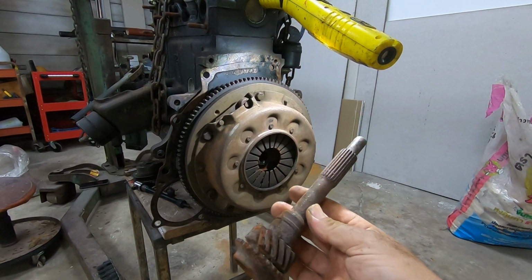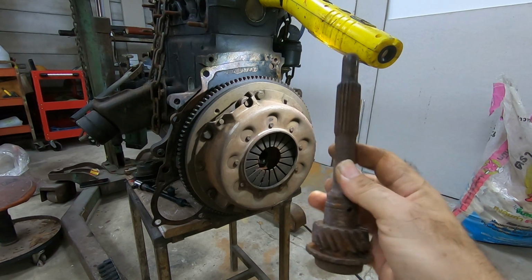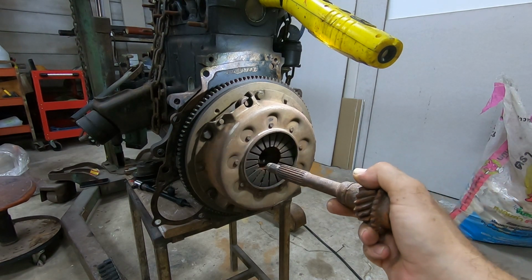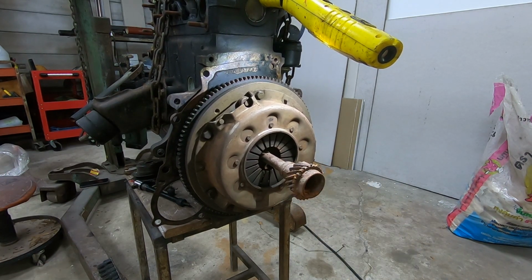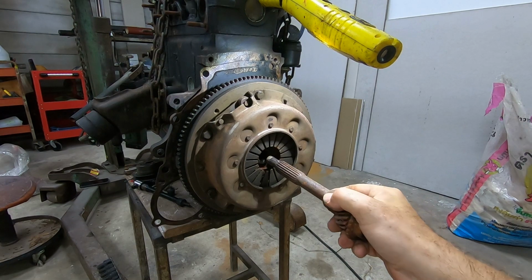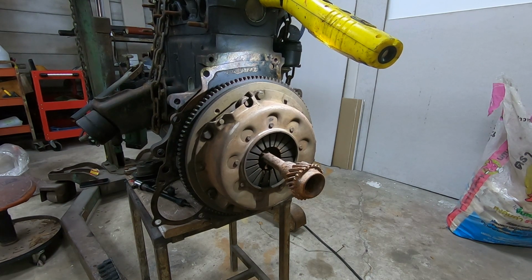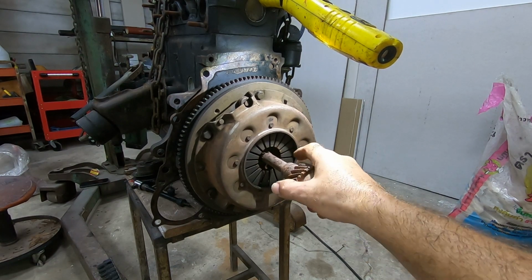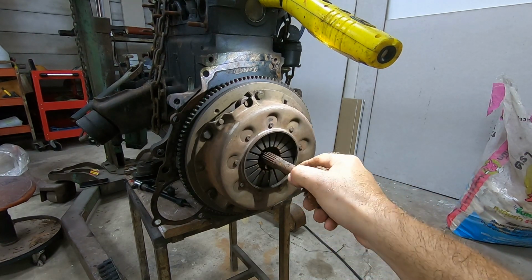What we have here is the remains of an old gearbox. It was from a flooded car and the gearbox had seized up. So I smashed open the gearbox to make the clutch aligning tool. I used to use an old socket, an extension bar and this, that and the other and wiggle like hell. But these are perfect. You can buy kits that are designed for aligning clutches. So you can't beat that. That is the best tool going.